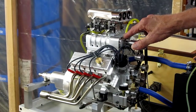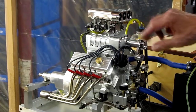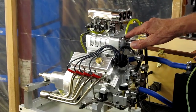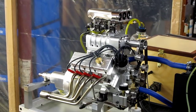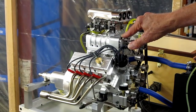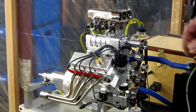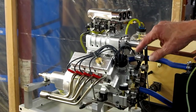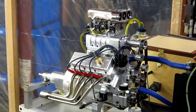The supercharger is based on the General Motors 71 series diesel engines — used to be Detroit Diesel — and that's a fairly popular supercharger that was used in the old school days of drag racing, maybe still some today. It's a straight two-lobe rotor design, and it's got about the same displacement on a per-rev basis as the engine. So if you're running equal speeds that would be neutral boost, and I'm running at about 19% over speed so I get some positive boost.